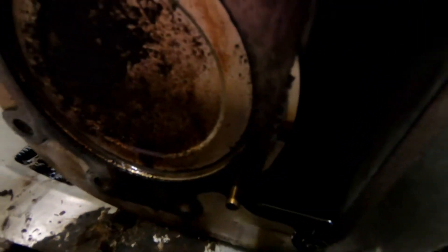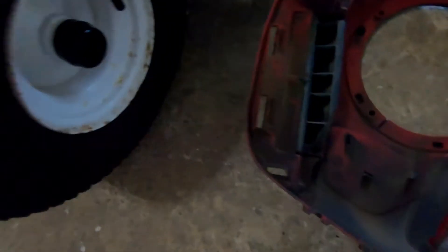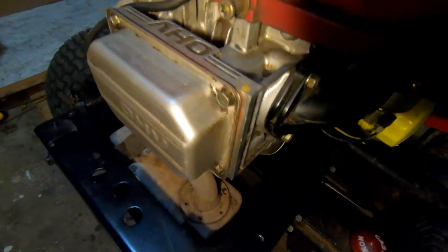This caused me to tear down the motor to find the problem. I took the head off and the head gasket was blown — even though this thing ran great. The crankcase pressure forced oil through the crankcase, and on this model it was actually coming from the breather tube that went from the crankcase to the carburetor. It leaked due to the excessive pressure from the blown head gasket. So if you see oil all over your motor, chances are it's a blown head gasket.